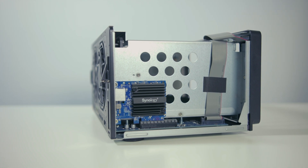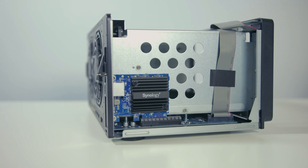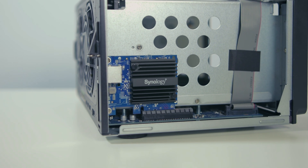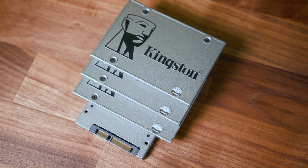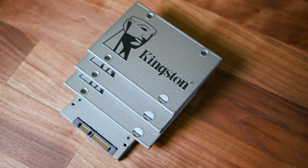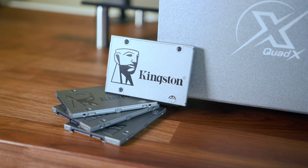You'll need a T1 add-in card compatible Synology NAS. I'll link the support page in the description so you can check which NAS are compatible with this add-in card — there are quite a few. If you've purchased a Synology NAS in the last year or so, more than likely if you got it in the mid tier it's going to be compatible with the T1. Next you'll need at least one SATA SSD — it's preferable that you have two so you can enable read/write caching. With only one drive you'll only get a read boost. I'm using two 960 gigabyte Kingston UV500 SSDs in this build, which I found to be really reliable and they come at an affordable price.